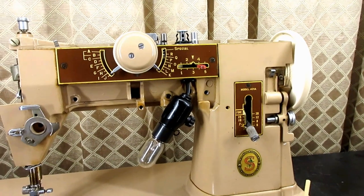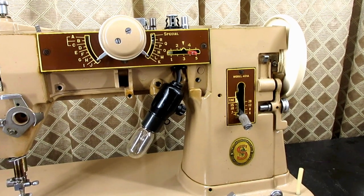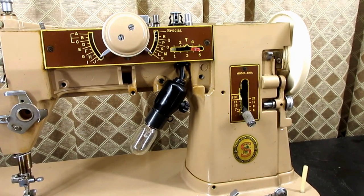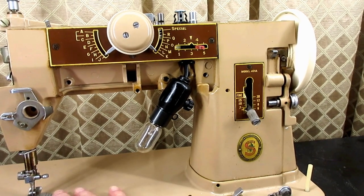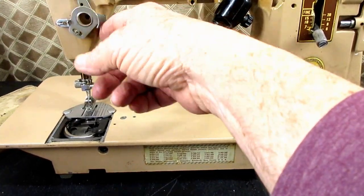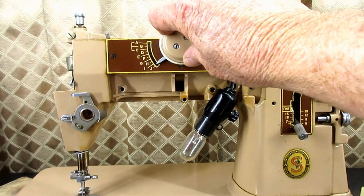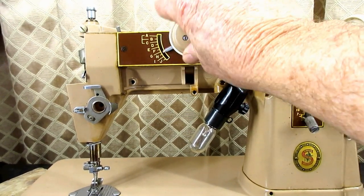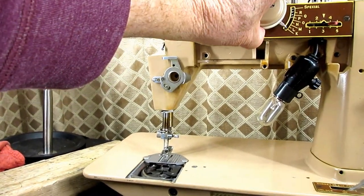And when you go to put your machine away, finish it for the day, lift your lever, take your lint brush. Take your lint brush and brush off the needle bar and brush off the sewing area, brush off the lint from inside your tension unit. And what the heck, it's only going to take a moment. When you go to put this back on AK3 or whatever, swing it a little bit a couple of times and spread the oil when you're all finished, okay?